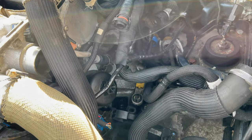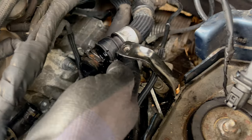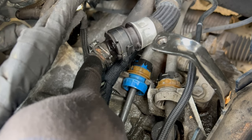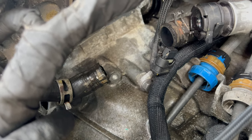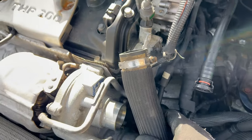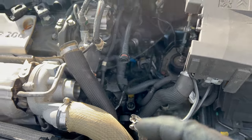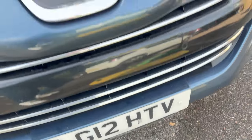Then remove the pipes or hoses for the thermostat - two here. This is a plastic connector so just push it together and remove the pipe. This one has a hose clamp on it, so push the clamp together and remove the hose. This one as well - that goes to the turbo. Two big hoses: one here and the other is here. Again use a 7mm hex socket, undo the clamp, and pull off the pipes. Obviously have something underneath to catch the coolant.